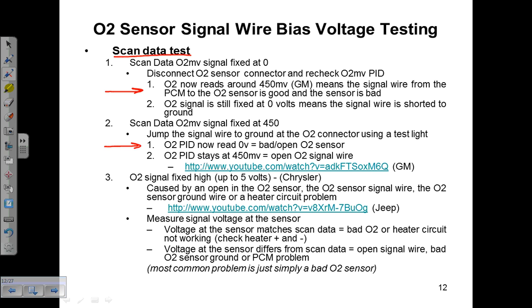Something I don't have written in here that I think is important to know: if the engine is not running and you do these tests on some cars, especially older ones, the computer may not update that data parameter. So you could be looking at the scan tool, it says O2 millivolts and you're reading 450, and you do this test where you're grounding that circuit out — the voltage on the circuit is actually dropping to zero, but the computer is not updating that data parameter because there's no RPM signal.